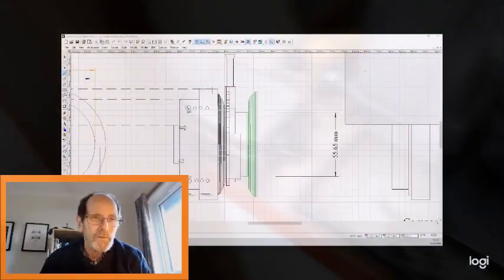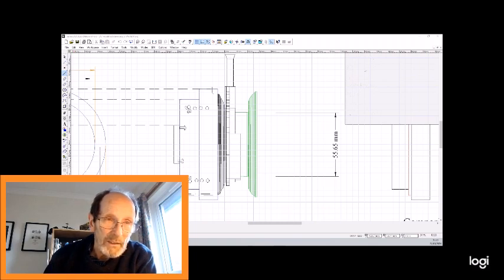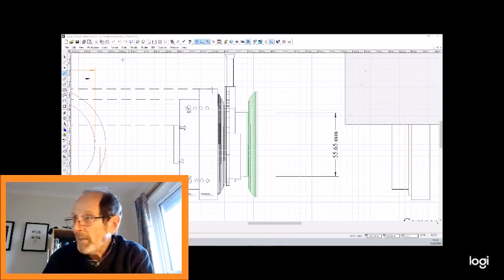The second part of this video covers the adapter required between the Austin 7 gearbox and the diaphragm springs on the clutch. And here we see, I hope you can see, in blue, that adapter. And then inside that is the standard Austin 7 release bearing, and the green bit there is the mounting on the Austin 7 gearbox.